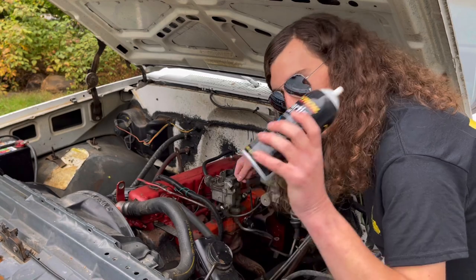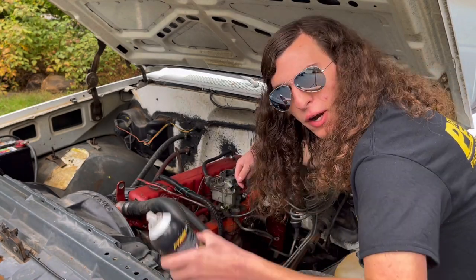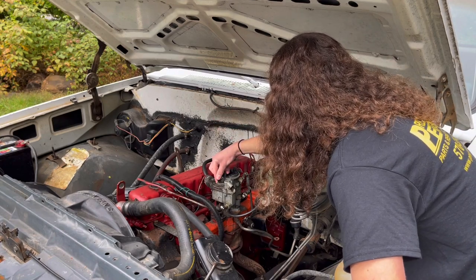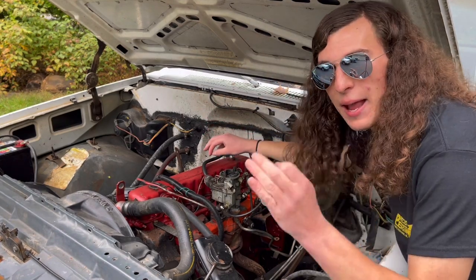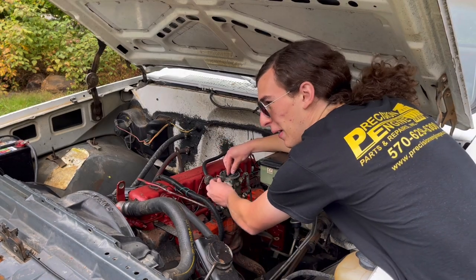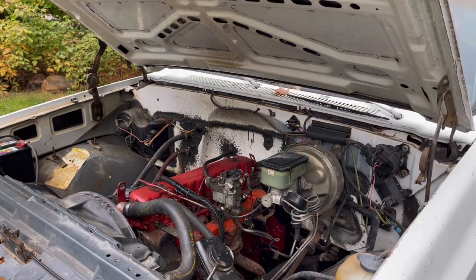It's tempting, I want to, but for the subscribers that are out there, I won't use the starting fluid just yet. We'll give her more choke. That's full choke. That's probably, we'll give her like 98% choke, see what that does. There should be fuel up to the carburetor by now, I'm thinking, from cranking her, so we'll give her a few more pumps and see if that helps. Oh, man. She wants to do it. She wants to live. Maybe you'll want to watch the choke. I'm thinking right about there should make her run. Let's try that.